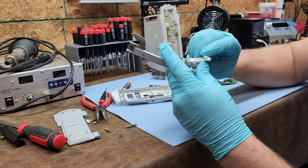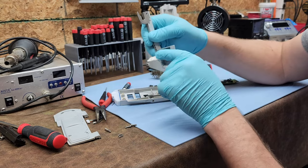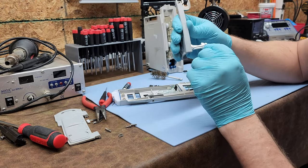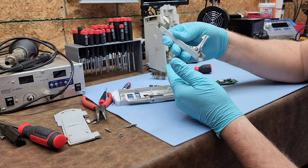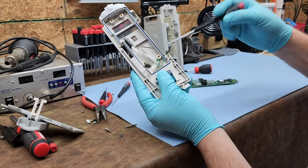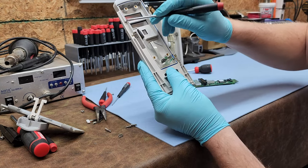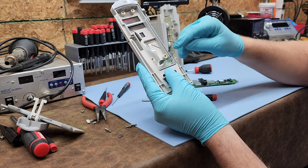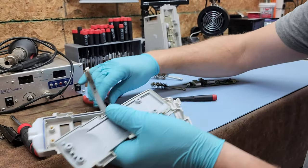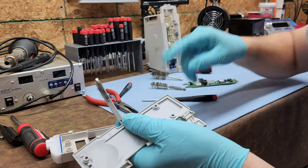Make sure you trim that spring correctly. The most important thing here is this pawl, which has multiple functions. On the older versions it has an adjustment; on the new version it's molded plastic with no adjustment. It adds a reflection for a sensor to detect when the door is closed. The cables come into the pump and there's a space for them, so make sure you seat the cable correctly. Also make sure this door seal hasn't pulled out, because if it has, the schmoo you see on the outside is going to be on the inside, and you are going to have problems.